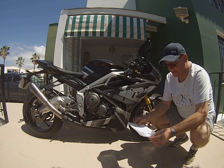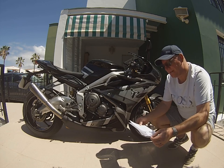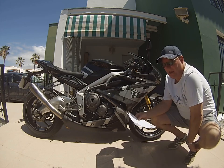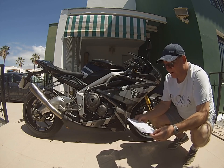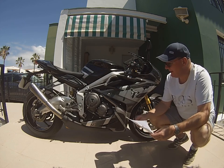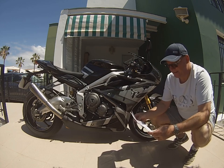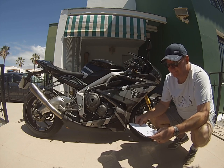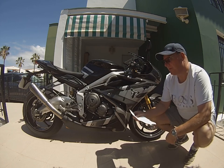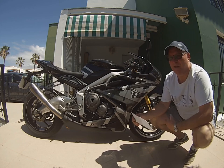Back to the rear: Pete's on 14 clicks compression and 14 on rebound — the standard is 16 and 16. So it looks like they've softened up the rear just a little bit. They haven't touched the preload interestingly. For a front-heavy rider on bad roads that's good, because it keeps the comfort level up and makes it much plusher on the crappy roads Pete has to ride on.